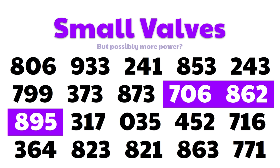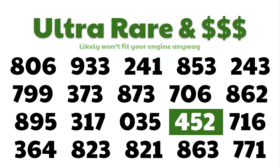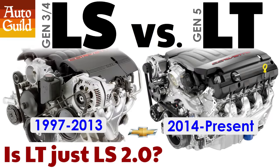And of these 8 families, there are really only 4 that you need to care about for your build. I'll also show you which cylinder head code came on every single LS engine, then I'll show you which of these heads have the biggest valves, the best combustion chamber, which ones are keepers, and which ones to avoid. We'll get into what fits your car too, and at the end I'm going to rank them all on a 5-point scale. You will not find a detailed list like this anywhere else on the internet, I promise. If you've seen my other videos, then you know what's coming.